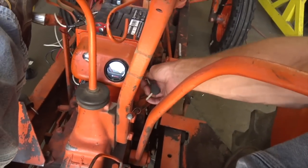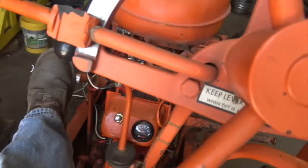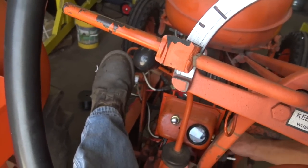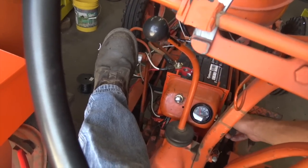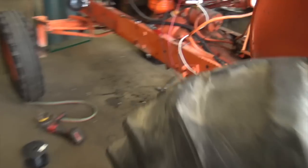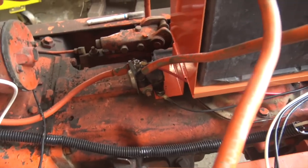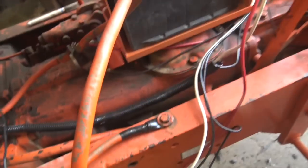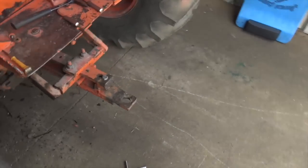Alright, this is the sink or swim part. Voltage gauge comes to life. Hmm, that should start it. I've done something or other incorrectly. So it turns out I actually had everything wired properly — I checked it over with the multimeter, and the solenoid should be getting voltage when we turn the key. The problem is it is not, so that tells me it's either a connection issue — you can see where I tried to clear up this ground here — or there's a problem with that solenoid, which really wouldn't surprise me because that thing's probably many times older than I am.